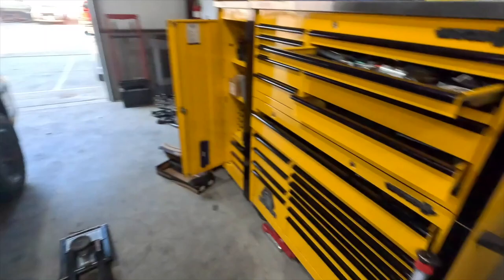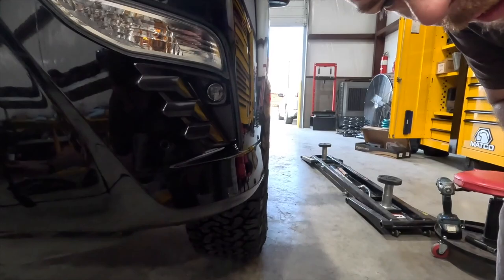If you are doing this at home and you need to drive it to an alignment shop, what I normally do is set the camber at maximum on the lower control arms. So maximum negative camber, and then loosen the tie rod adjuster and just look down the edge of the tire until it's basically flat with the back tire. Just catch a sight line.